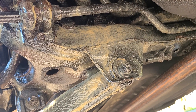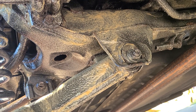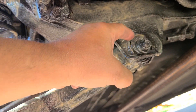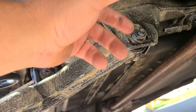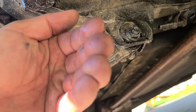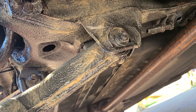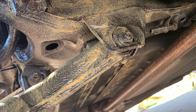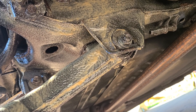Here's the other thing. If you take it in for an alignment, something that you may not be able to do as a DIYer, you want to make sure these all break free and clean for the technician. Otherwise, we've got to order parts, we need to weld on hardware, we need to take the subframe out. You want it to be as easy as possible to save you, the DIYer, as much money as possible. Because the easier it is for them, and the easier things come apart, they can't say 'well, this broke and that snapped.' Every time you hear something like that, the tally goes up.